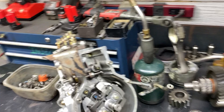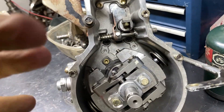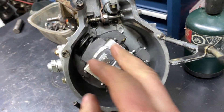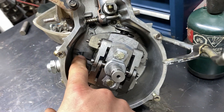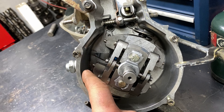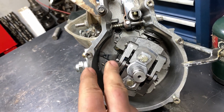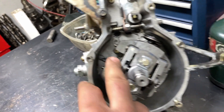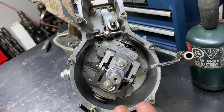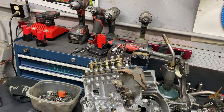Another neat thing while I have this pump here: with the timing slot pin — that's the back of the pump, it's your governor assembly, where the springs are, and that little indicator thing — one trouble with relying on it is if some monkey along the way bent it out of whack, it can be off. Or even what you think your eyeball is lined up with the center of the hole could be off a couple degrees. So you could set your engine to 18 degrees and it could actually be at 21 or 13. That's another perk of the spill port timing method.